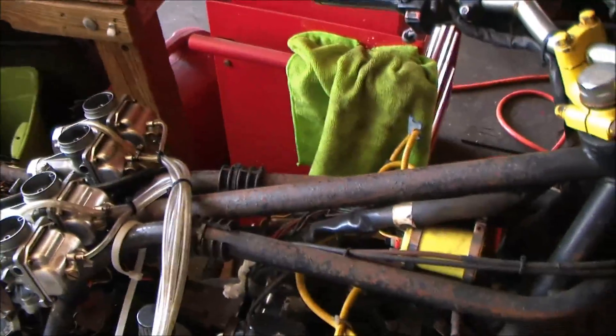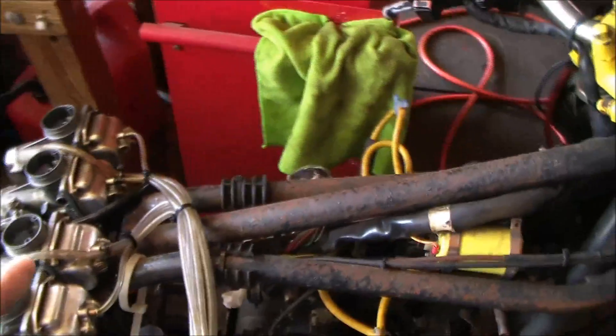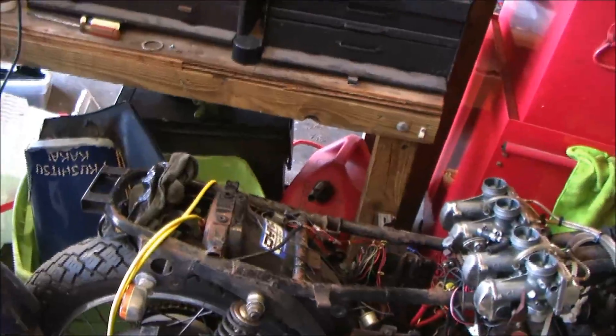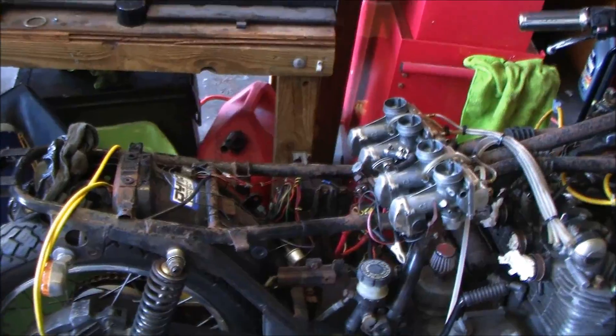Because he has a Kawasaki, I have to mention: if it proves to be the stator on a Kawasaki or Suzuki, you're replacing your rectifier too. If it turns out to be just the rectifier, replace only the rectifier. But if it's the stator, replace them both at the same time — a new stator will take out an old rectifier in a couple of months. I can't tell you how many bikes I've bought because somebody replaced the stator and two months later the rectifier blew.